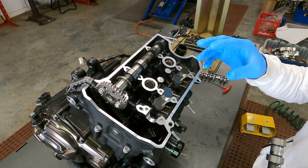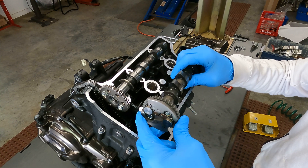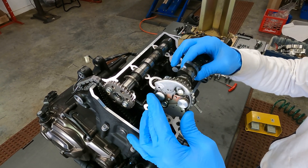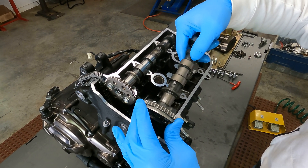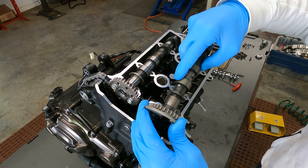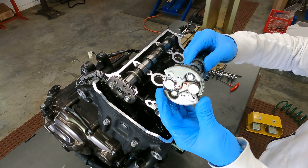This engine has two of these — there's one over here as well. They just barely open the exhaust valves and bleed off a little compression. That slight reduction in compression lets the engine really start to spin. Once the engine fires and starts, by centrifugal force these weights sling out, and you can see the pin moves — in the slung-out position it's just below the surface and is no longer touching the bucket.